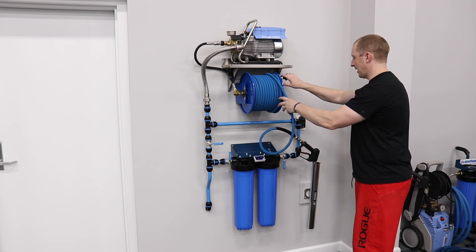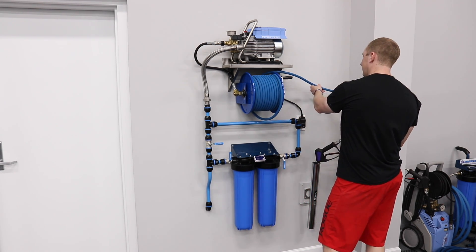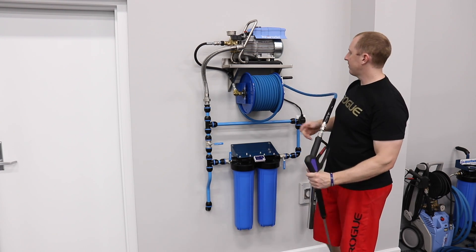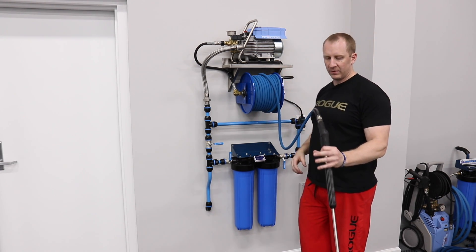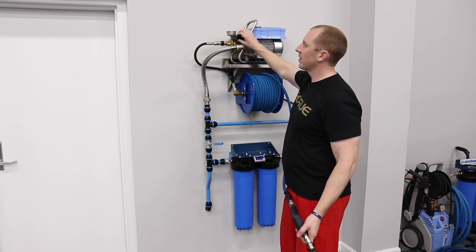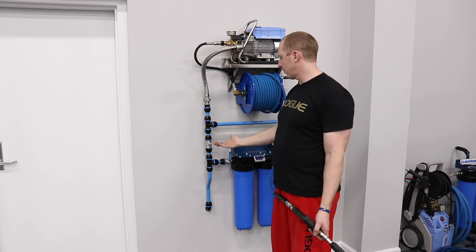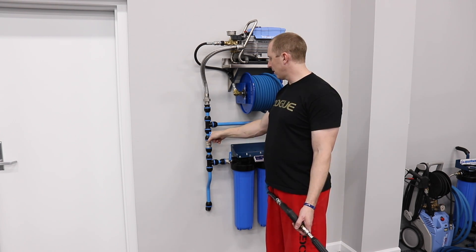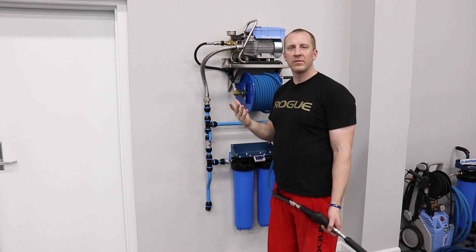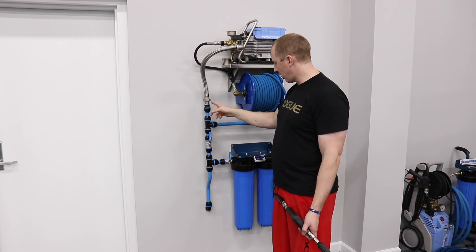If you're going to wash cars all the time, you may just want to leave the pump connected and holstered — figure out a way to position the hose nicely. If you left the water running and everything was taped properly, there wouldn't be any leaks and you could leave it pressurized all the time. Because we have a pressure switch, we don't have to worry about on/off. When I want to start washing, I turn the water on, you can hear it filling up the line and hose, then turn the pressure washer on — notice it doesn't flip on immediately because of the pressure switch.